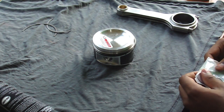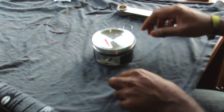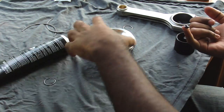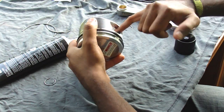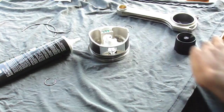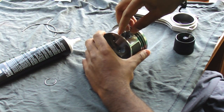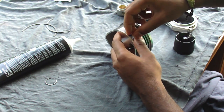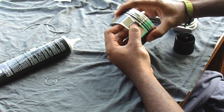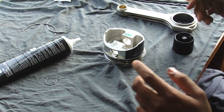First step to connecting this piston to the rod is going to be putting a retaining clip on here. Get some assembly lube and just pick a side and put some assembly lube in there. Now put your retaining clip in here — the way I'm doing this is the side that's open, kind of just push that in first, and then as that slides in you just gotta push the back in and it'll snap in place. You can't even really see it. Retaining clip is in — now we're just going to lube up the rest of our parts.